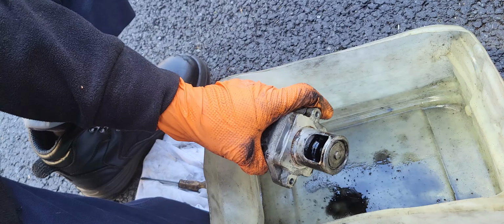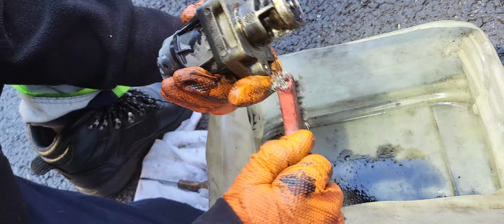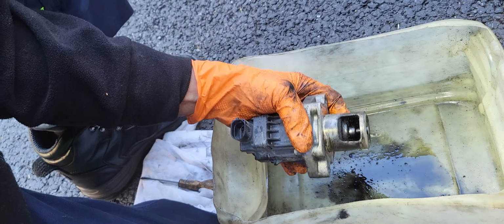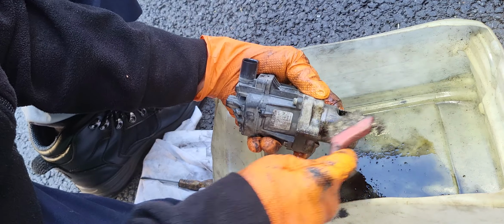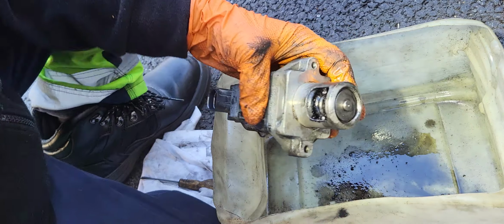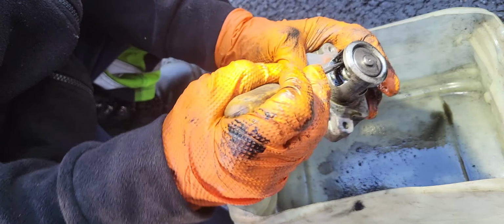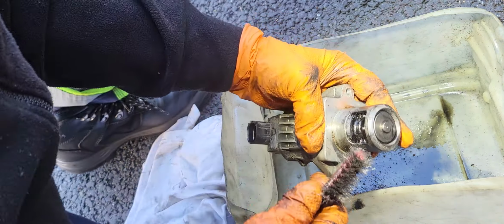If you have an EGR problem on your engine, guys, this will affect the performance. Like an EGR clog, then the engine has trouble with loss of power, or limp mode. So to avoid that limp mode and loss of power, you have to clean the EGR regularly, like once a year maybe, it depends. And if you don't know how to remove parts or how to clean the parts, then you can message me. Okay, so we're gonna clean this EGR here as we can.